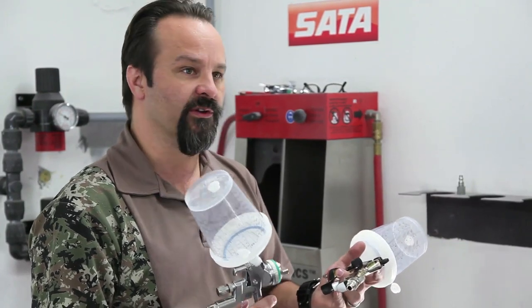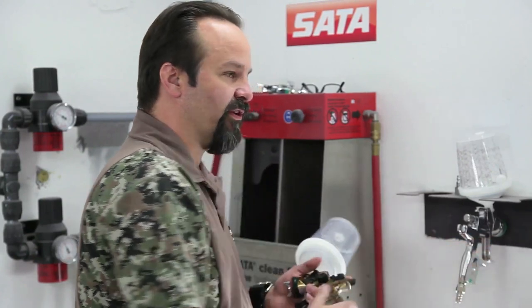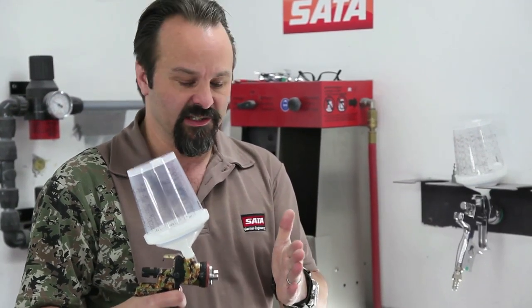When it gets hotter — especially in desert conditions where it's hot and dry — I may turn that down to 24 pounds on the clear gun and 23–24 PSI on the base gun so it wets up properly. When you do that, you also have to remember with these guns not to spray at the 8 to 10 inches that many people were taught years ago. With this gun, when I plug it into air I want to move in until I hit a wall of air pressure.